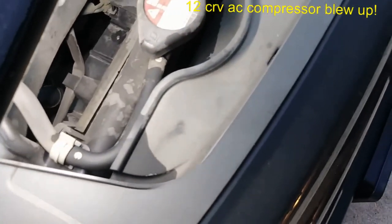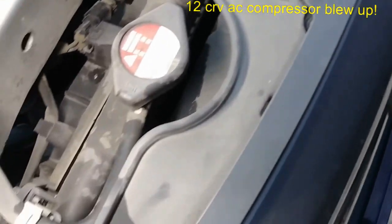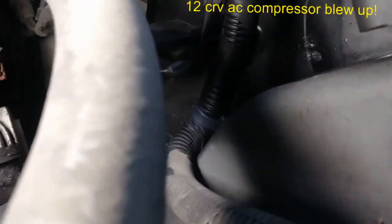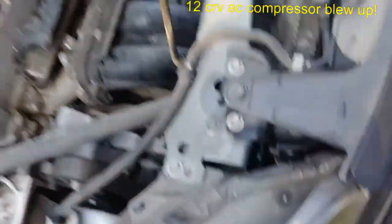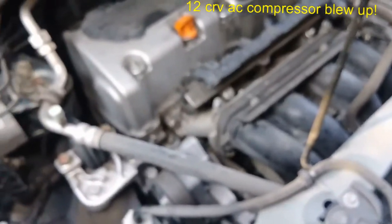But furthermore, as you can see by the stain, it's supposed to be all dusty. Well, look at those oily spots all over. And you come this way, see what's going on there. Wet, right? So Freon all over the place there. Not only that, not Freon, actually, it's PAG oil. Look at here. What do you see? Metal shavings all over the place. So basically a case of Black Death.